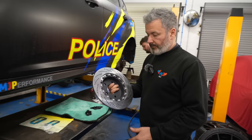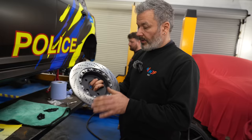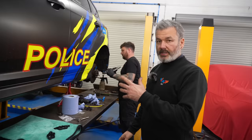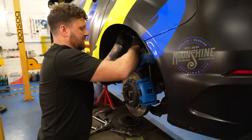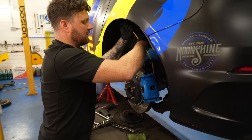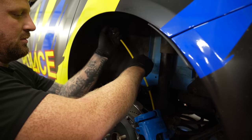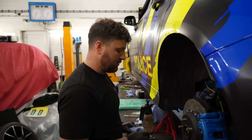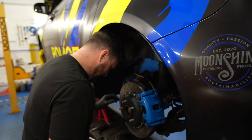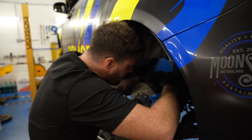So Martin, what exactly are you doing to the rear brake setup on the RS? The original disc off — this is a 300mm disc. The difference is that's a solid one-piece, this is a two-piece with a custom bell built onto it, specifically for this application to go with the Revo wheels so the offset's correct, matches the front, and the stance is correct. It's cross-drilled. Mike has efficiently put together the rear brake setup and is doing the braided brake lines now, which is a really good upgrade for any car even with standard brakes. He also needs to bleed the system, which can take about 40 minutes. Big credits to him and Martin here at MJ Performance.